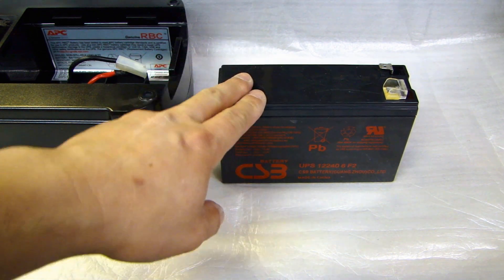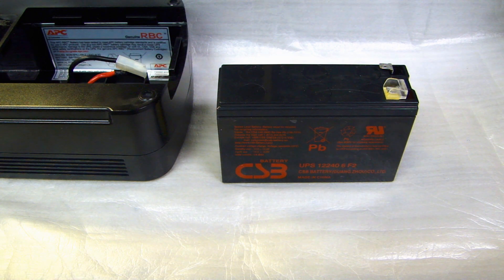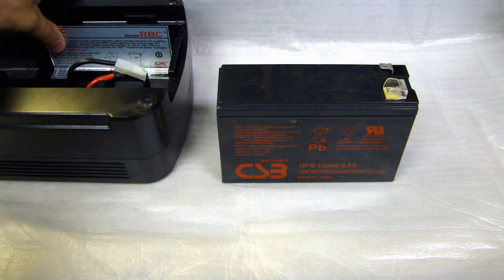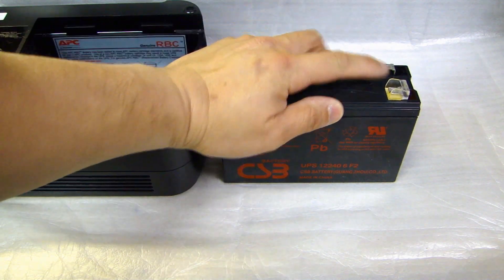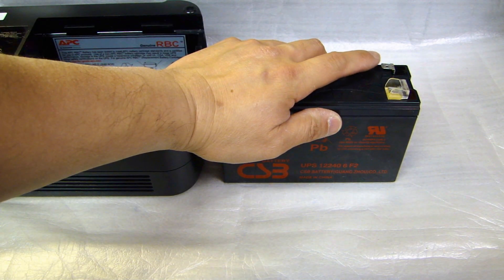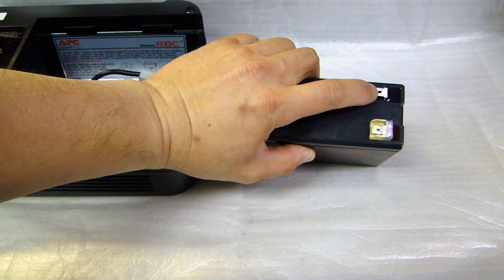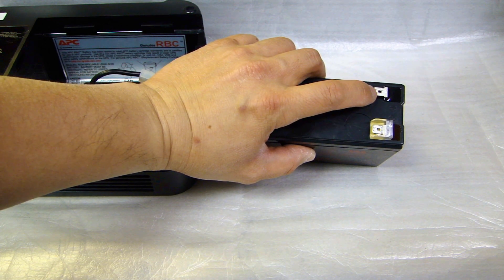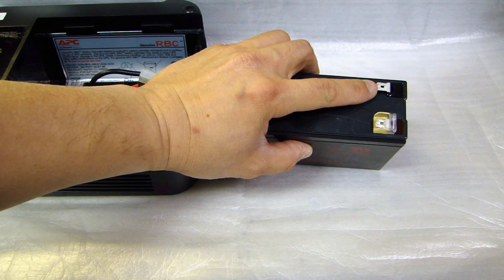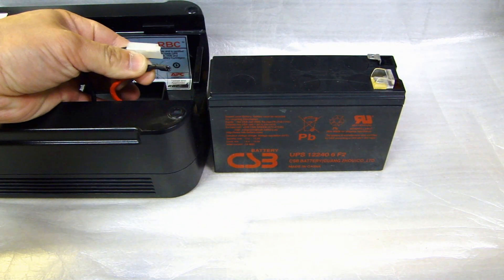I've found out that this battery is rated at 6A and 12V, and the dimensions are 6-inch by 2-inch by 4-inch — that is a size that will fit in this compartment. The other thing to note is the terminal size. There are two different sizes: F1 and F2. The F2 terminal is the wider one, and the F1 is the more narrow terminal. Keep that in mind when looking for a replacement, because if you get the wrong terminal size it won't plug into the connector.